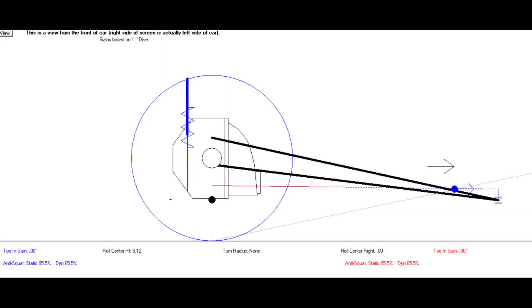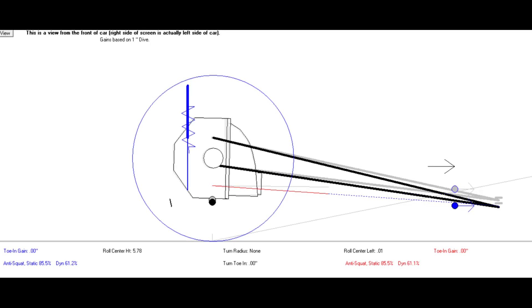Since I mentioned that I have a torque arm, that is the only suspension I'm going to focus on for this video. Here is my current model of the rear suspension, modeled in Suspension Analyzer. Most of the parameters are dictated by the Maximum Motorsports design. The side view swing arm length and the instant center forward location — the blue dot — is defined by the length of the torque arm. The roll center height — the black dot — is defined by the panhard bar height. As the suspension compresses from acceleration, the instant center moves down and the anti-squat starts to decrease.